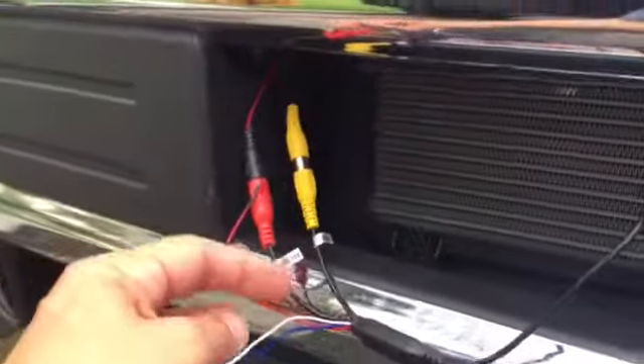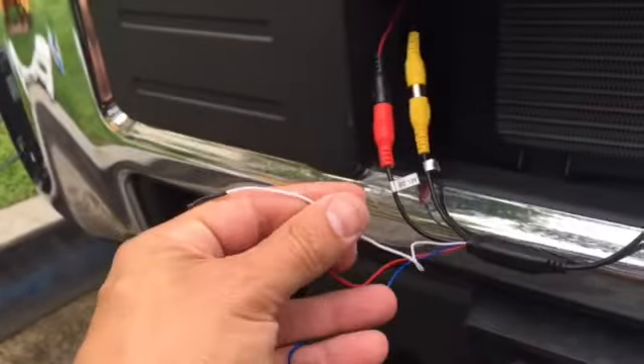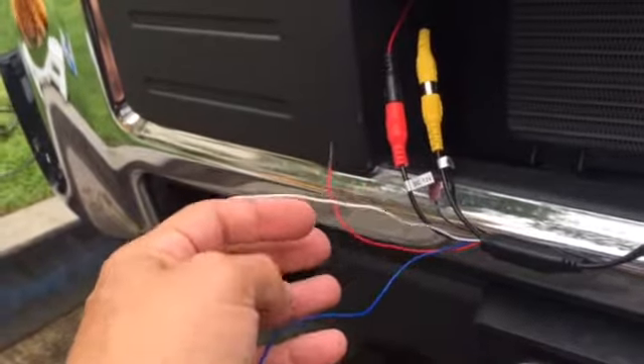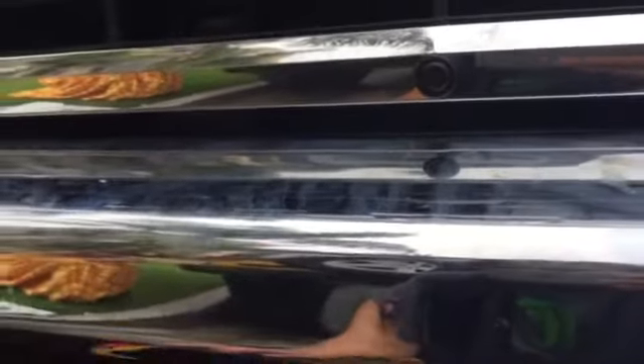I haven't hit these wires yet. This allows you to put on a scale in front if you want to see how close you're going. The blue is the scale and the white is actually to reverse the image, because typically the image is always reversed for a back camera, so you need to adjust that to see the front image correctly. I hope this helps, and hopefully if you need a front camera on your Silverado, this will help you do it.